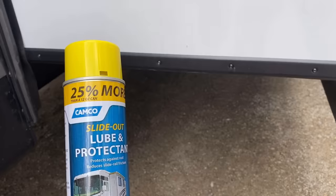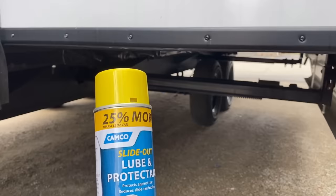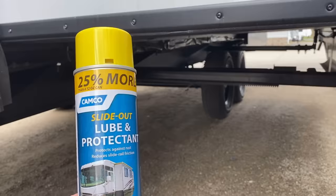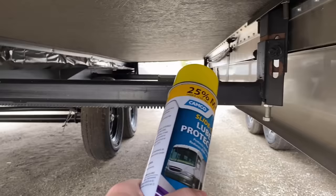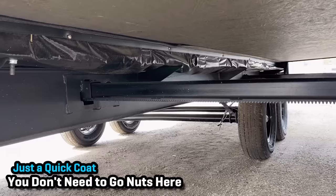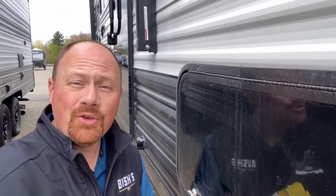There are several varieties of lubricant that work well. What you're going to do is pop the top off and steadily go down the slide — basically anywhere you have that gear, there's one here and one on the far side since this is a big long super slide. Give it a light coat, like a very light coat of spray paint. You don't want to spray it until it drips. And here's a pro tip: this same slide system gear lubricant for rack and pinion slides can be used on any external hinge on your RV — like a squeaky baggage door hinge. It's good for more than just one purpose. I'll leave a link in the video description, though I'm not a sponsored guy so I don't get paid if you click it.